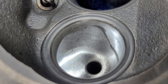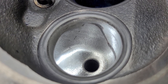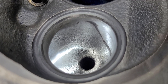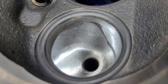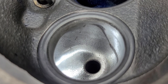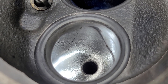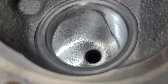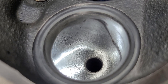That thing turned out really nice - it was 275 on the intake, 200 on the exhaust. The only mod they did before I ported it was they made it 2.02/1.6, three angle valve job. That was no development - that was just go in there and figure out what it needs. That was one cut, and on the bench, 275. Not bad. I did that for Marvin - he was like, Charlie, I'm doing these for a street engine, what do you think you could show me? It took an hour or so and I had zero Vortec experience. That was the first Vortec chamber ports I ever touched, and they turned out really well. So I'm gonna get to work on those. He has an old cracked Magnum head that we can use in comparison - so that'll be kind of cool, having them right next to each other.